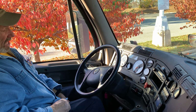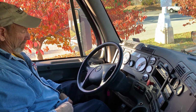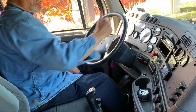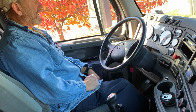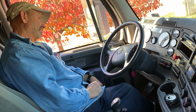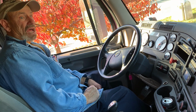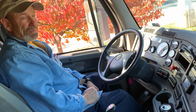Now, I'm going to firmly apply my foot and do the apply pressure check. I'm going to firmly apply my foot to the service brake. And once again, the key word is I'm going to allow air pressure to stabilize. So I'm going to let the pressure stabilize again. Air pressure has now stabilized, and you can ask the examiner to time you 1 minute.